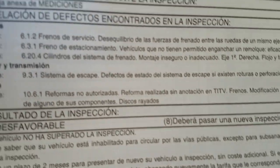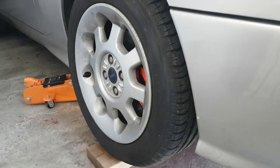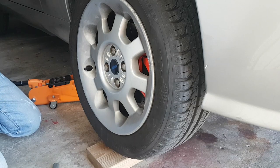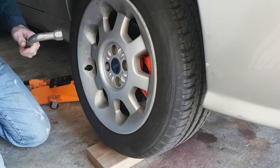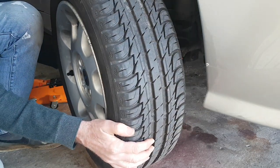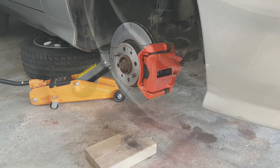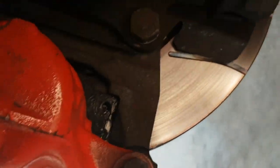So we'll go and look at the car now and look at all these little problems, and see if we can see exactly what we've got to repair. The first thing I want to check is the front brake caliper and the missing screw. I've got it on that bit of wood because the car's too low for the jacks. I'll turn the wheel so we can get a better look at what's going on — and it looks like it might have snapped off. I'm going to have to take the whole thing apart to see.